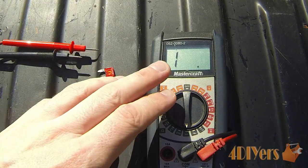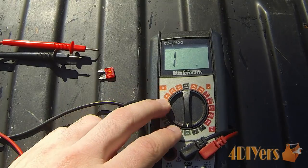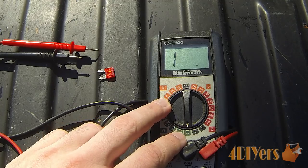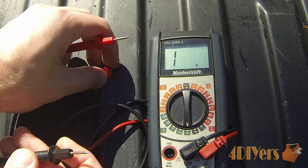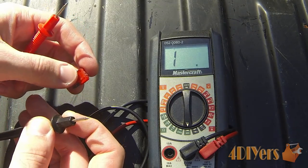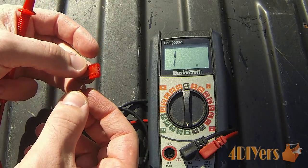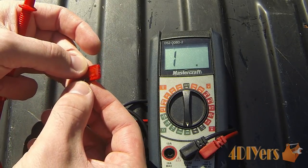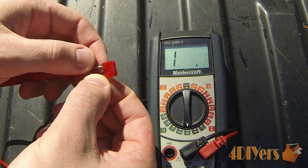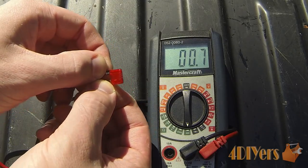For the last test, we can use a multimeter to do a continuity test. I've set it to the three-place ohm setting as you can see. Just taking the two test probes — and remember, you want to do this with the fuse out of the vehicle, because the resistance test puts a small amount of current through that can damage electronics, especially in newer vehicles. Touch one pin with one probe and the other pin with the second probe, take a reading, and you can see that this fuse is good.